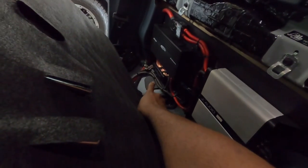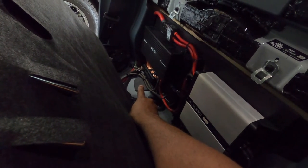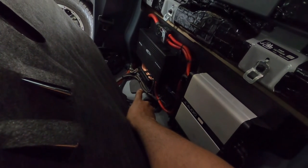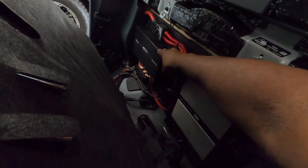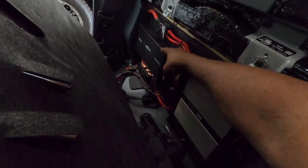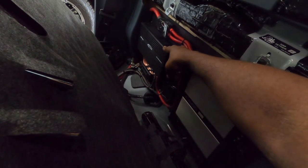The amps are on the passenger side. We have the Audison USS4, which puts a load on the front and rear inputs so you don't need load resistors. Then we have the Arc Blackbird running 8 channels: channels one and two to the tweeters, bridging three and four to the mid-bass, five and six to mid-bass, and seven and eight to the rear speakers.